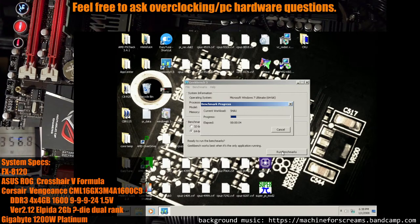No, I'm using a 240mm Arctic AIO. This is a really old Arctic AIO, so it's one of the Asetek rebrands. Not one of the later ones, when Arctic started to make their own AIOs, as in own pump design, own everything. Whereas this is just an Arctic spec radiator, but with an Asetek pump and cold plate.